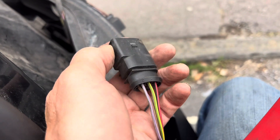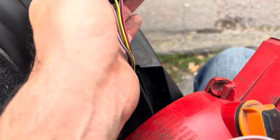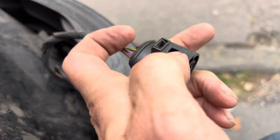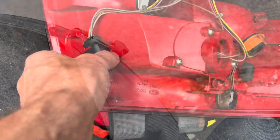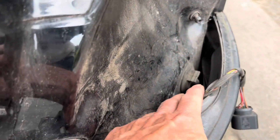To fix this light we're going to take the whole thing away, and the easiest way to do that is to unplug the whole unit here. That little catch hooks underneath a hook in there — to get it off, push it back towards the wires and that will lift it up and allow you to unplug. These plugs should be clipped into the lamp and not just lying loose.